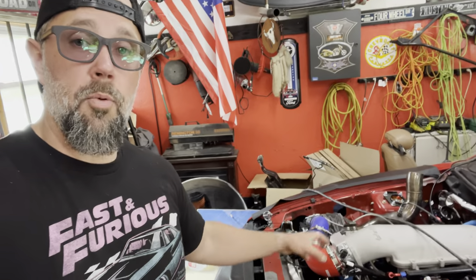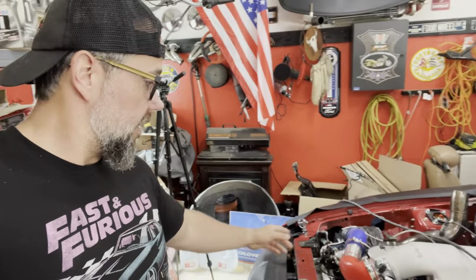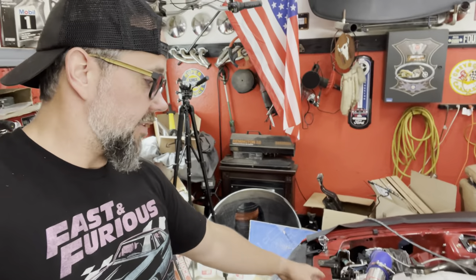It's the next morning and I'm back to messing with the car. The only thing we really haven't verified is whether the dual sync is installed correctly — we know we have spark, fuel, and the dual sync is giving an output, but we don't know if maybe I screwed up when I put it in and it's off on timing. So I'm going to try to check the static timing. I tried yesterday but couldn't see it, so I'm going to take off the turbo charge pipe, maybe some pulleys, whatever I need to do to see the timing light working and verify it. I also redid the balancer mark — I cut a piece of cardstock paper to 2.8 inches, which should be 50 degrees, and put it back on the balancer to make sure the timing is right. If it still doesn't start, it has to be something in the tune because I can see all the sensors working.